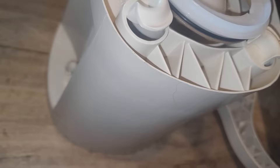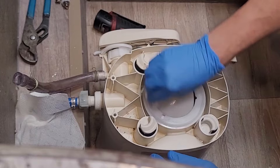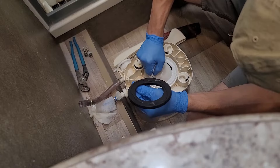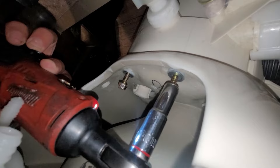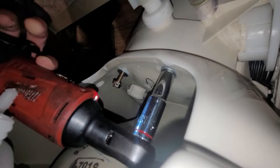Now that the waste ball is attached, grease the surface of the ball as well, then replace the plastic ring. Reinstall the foot pedal as shown earlier, then wipe off the mating surface for the gasket. For good measure, coat the mating surface and gasket in silicone grease. Insert the new gasket and replace the toilet with a clockwise twisting motion, then align the holes with the threaded mounting holes in the back — I use my phone's camera to help see what I'm doing. Ensure the metal washer is on the bolt first, followed by the nylon washer. Hand thread the bolts, then tighten them. Don't over-tighten, as you may crack the toilet bowl — gently wiggle the toilet to check, and tighten until it doesn't move much anymore.